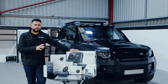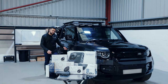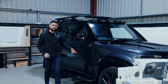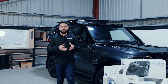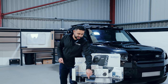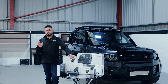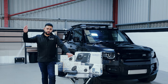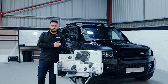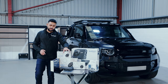The soundproofing makes such a fundamental part. A door card — if you listen to this — that is not a good place for sound to be performing in. You need to build a better environment for that system to work in, and that is exactly what that product does. This product makes the speakers sound a lot better, and that is why our reputation has grown to where it is now. It is honestly products like this — the fundamental parts of doing a system — that make the difference. So that is the three-mil layer, 40 sheets going into this vehicle.